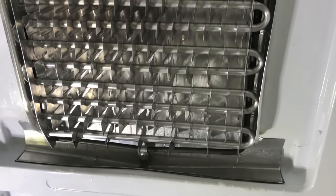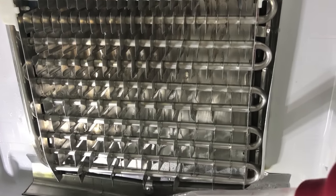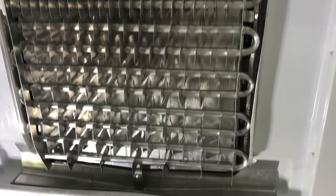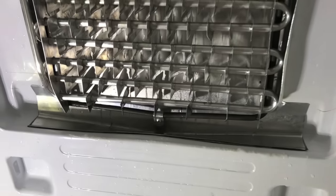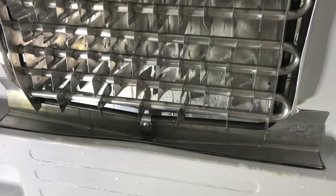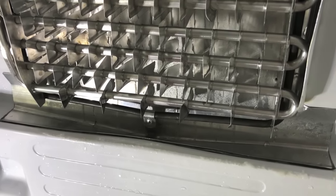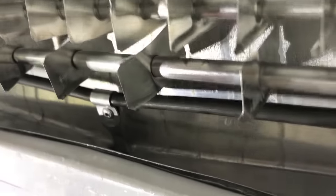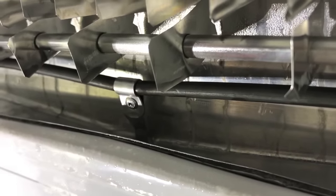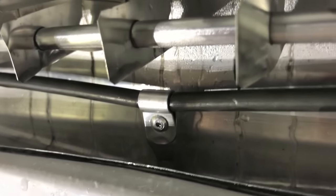After cycling through a bunch of hot water with the turkey baster, you can see the water is draining out now. I wouldn't recommend pouring much water in because it goes into an evaporation tray at the bottom of the fridge and could leak out. The ice is all gone and water is actually flowing through there. The next step is to remove the factory clip.